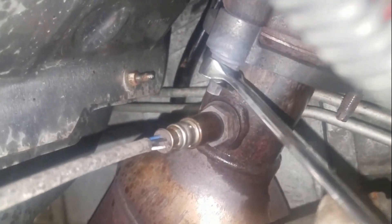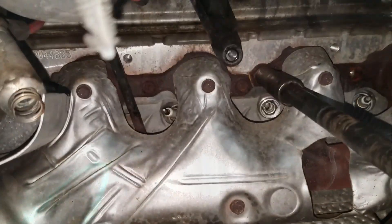On the passenger side I was able to get two of them off and I've got this one left, going in through the inner fender. I'm going to heat this one up and wrench it out by hand. I could just cut it off but it's just a little tidier — you don't get metal dropping on the floor and causing a fire hazard. Sorry about the shaky camera, I'm doing this all one-handed while holding the camera. There we go — that one broke free.